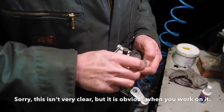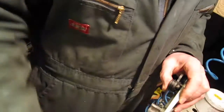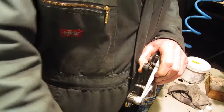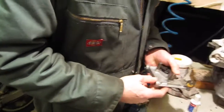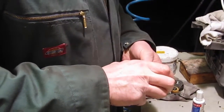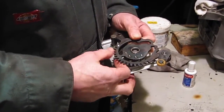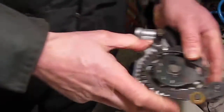The new spring goes into position — it's a little bit fiddly. Get that up and over so the groove appears, then put the new clip in. It just slots into position. Then we can start replacing the cam plate — there's the white mark for the groove, that needs to slot down into position. This spring needs to be pre-loaded. There's the spring in position.